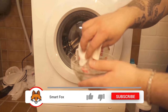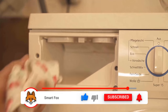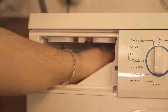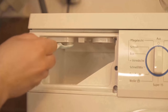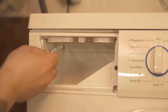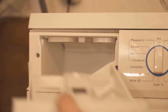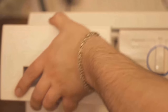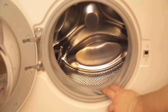If you don't have citric acid, I'll link it below in the video description. Now we mix everything well and start wiping out the inside of the drawer compartment, including the nozzles at the top where the water comes out. For the nozzles you can also use an old toothbrush, dip it into the mixture and wipe the top with it. You can clean the drawer itself with the mixture or put it in a dishwasher. Once clean, simply hang it back up.